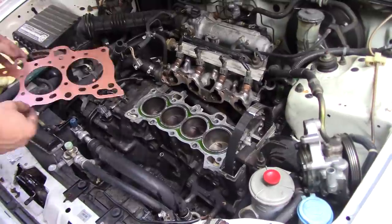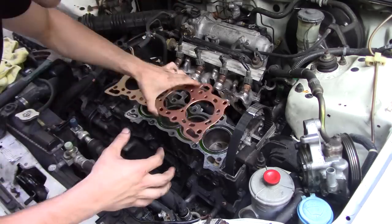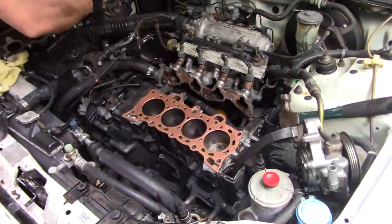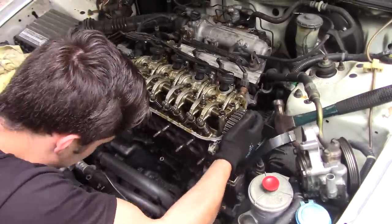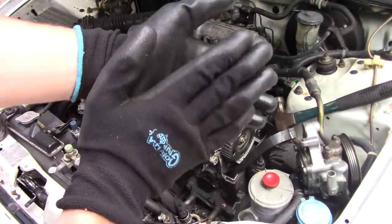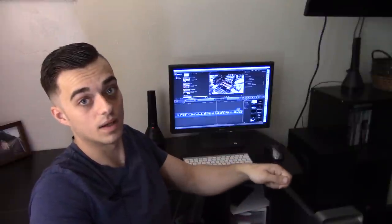I did about three coats of the copper spray gasket on top of the new gasket. This ensures it will last longer and fill in any small imperfections or gaps. Putting the head on top of the gasket was kind of tough — luckily I got it on my second try, but this usually doesn't happen easily. There are also little alignment pins on the bottom of the head which stick out so you can line them up with the holes on the block.